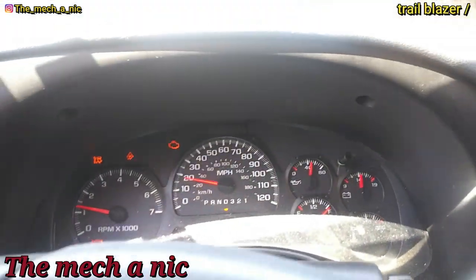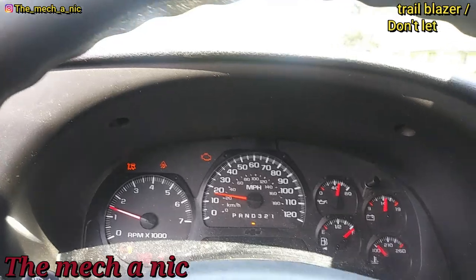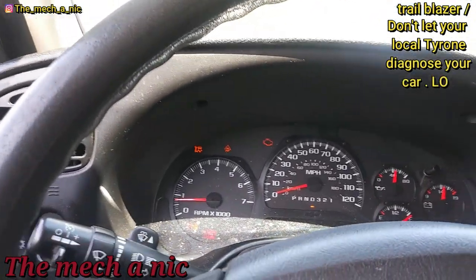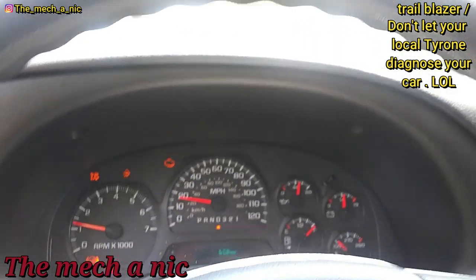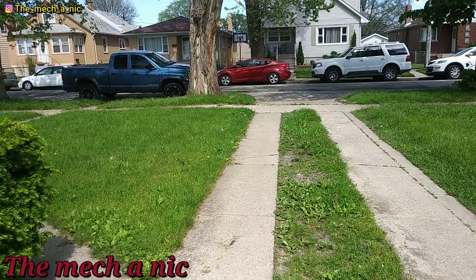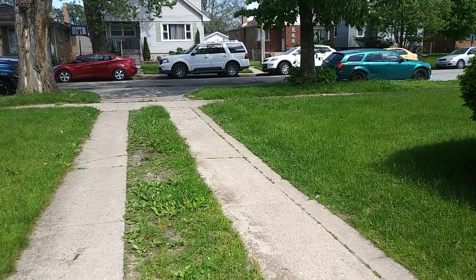I'm out in this Trailblazer with a Christmas tree of warning lights on. I just finished doing the front pads and rotors. The owner brought it by because some guy told him he needs front wheel bearings, so he came over with a complete kit from 1A Auto — two front wheel bearings, front pads, front rotors. I gave him a quote just for the wheel bearings, jacked up the car, looked at it, and there's nothing wrong with your wheel bearings — it's just the brakes. He couldn't believe it. Got the brakes on, took it for a test drive, and all good now. All right — we have a blue truck that's a no-crank, possible starter issue, and over there a yellow car with a flood issue from driving through a puddle and the engine turned off. Choose which one you want to follow.